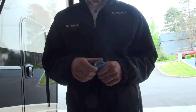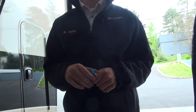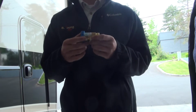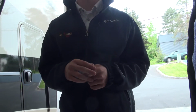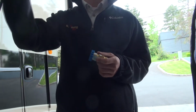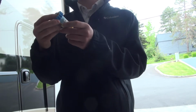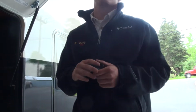You're going to find owner's manuals and literature on literally everything that I cover. You're going to have weeks of material to read through. As far as this, it's just pressurizing the water coming from city, quote unquote. You never know what kind of pressures come in there. And of course, when you're on city water, you won't need your water pump to do the pumping and pressurizing. So that's kind of what this guy does. However, these are set to 40 psi. Okay.